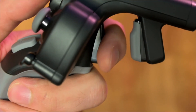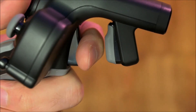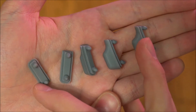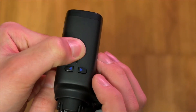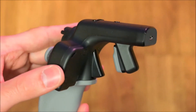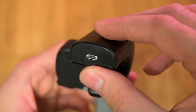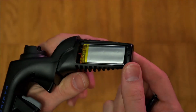The analog potentiometer-based trigger is linear and devoid of any tactility. At its opposite side is a push button switch-based shoulder button, intended to be pressed with the back of the index finger. The three buttons at the top of the controller are also push-button based; aside from start and select, one button acts as a power and profile selection button with inputs via different kinds of long presses. The gyroscope module can be toggled on or off by simultaneously pressing start and select. At the nozzle of the Grifter Morphing Gamepad is a USB Micro-B socket for charging. The unreleased Antler accessory was supposed to slip over the nozzle and would have contained its own battery to power itself.